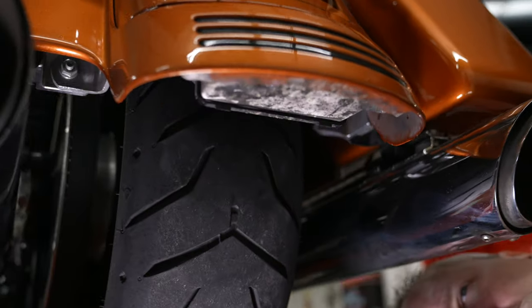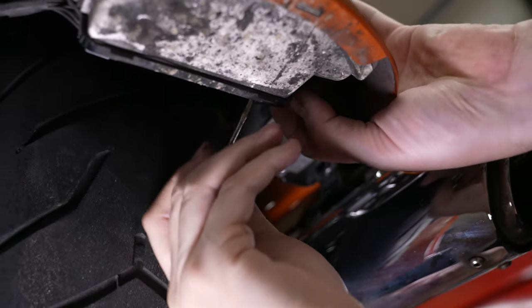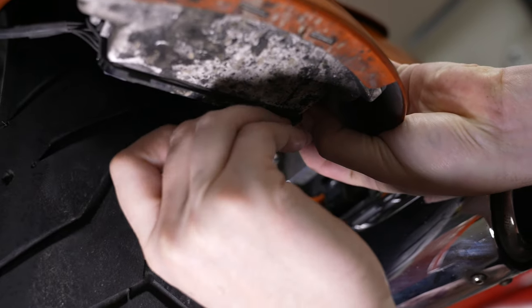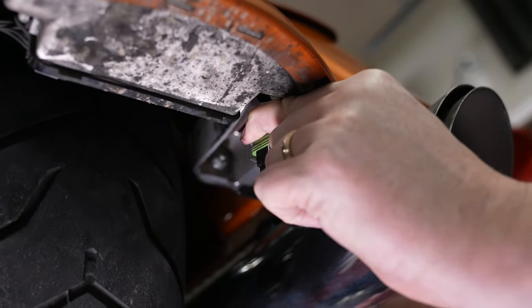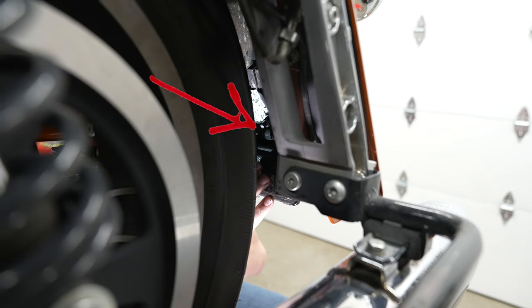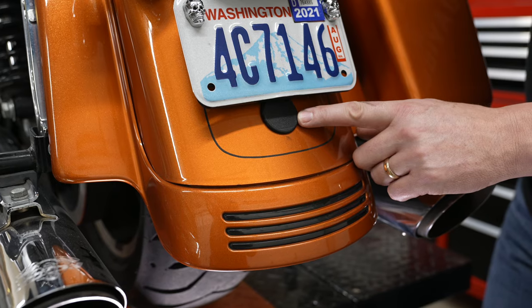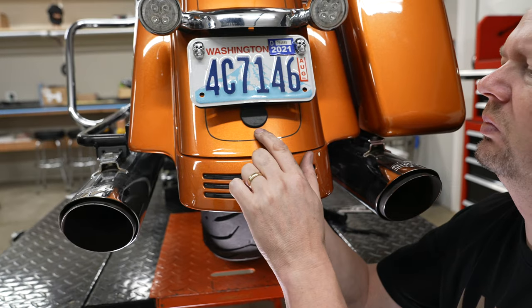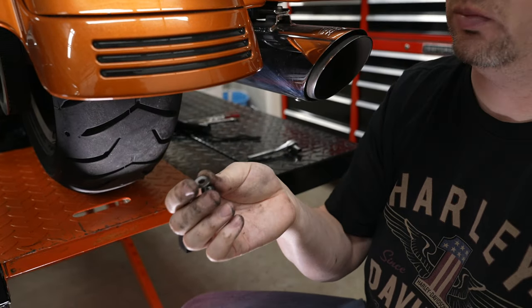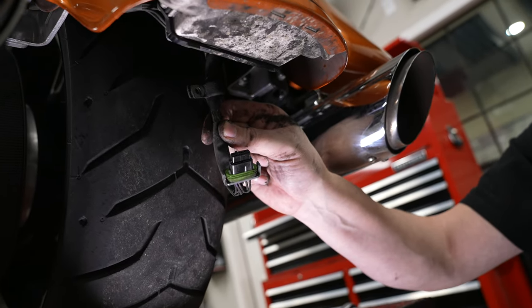Coming underneath the back of the bike to where we took the dust cover off, you'll see the main wiring harness — it pulls out on the right side and there are little tabs, one on the bottom and one on top. Just stick a little screwdriver in there and pop those, then unplug that main wiring harness. On the back side is the 7/16-inch nut. Use a socket or box-end wrench — whatever works. That frees the wire we unplugged from the box and gives you some slack to play with.